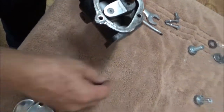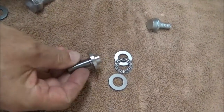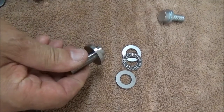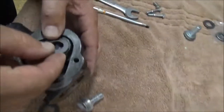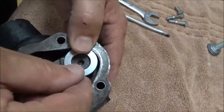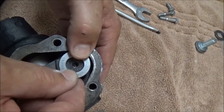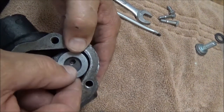What we have is a replacement kit. This is what we offer here — it's an adjustment screw that's a different, smaller diameter, and then smaller thrust washers that clear the edge of the box so there is no interference and you can get a clean adjust.